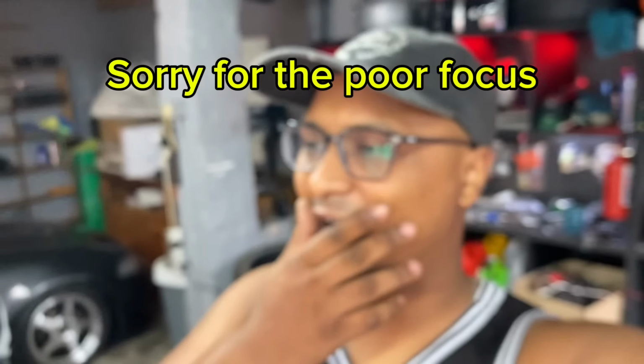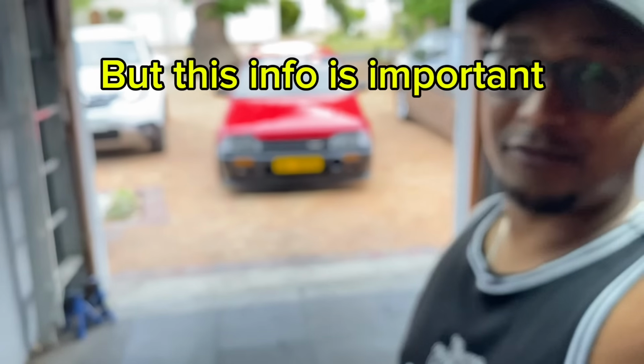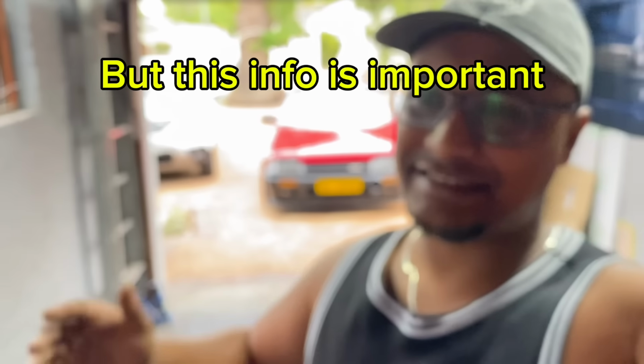Guys, as you saw last night, I got the Mazda up and running finally. Fun times. This box feels fantastic. It sounds great. Topped up the oil so the sounds are gone, so it's really doing well. The only issue I'm having is that the lift on the car is very soft. It sounds like only the intake side is coming open, and after some testing last night I did figure out that it seems as if the exhaust side of the lift is not working.